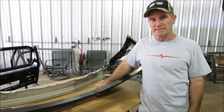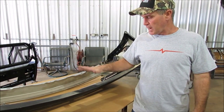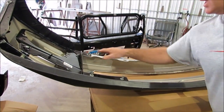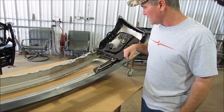This is the front end install for the 2010 to, as of now, 2017 Dodge 2500/3500. We've taken the chrome bumper off here. These are the four bolts right here that you need to undo from your frame cap on your truck, and you've got four more over here on the same side.